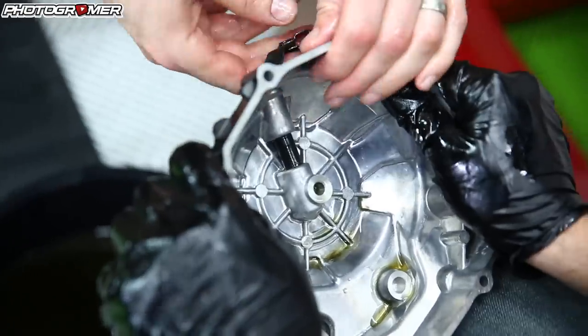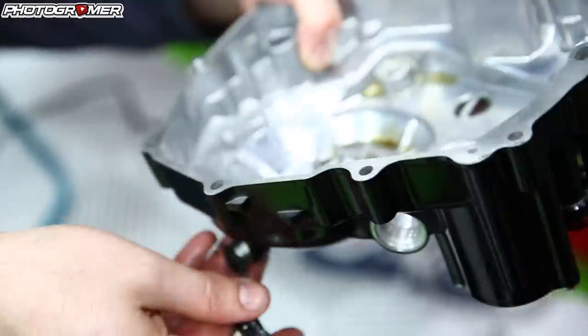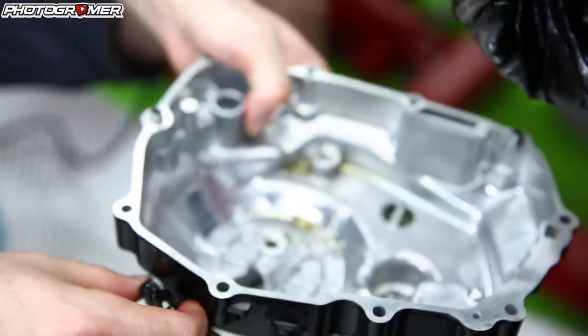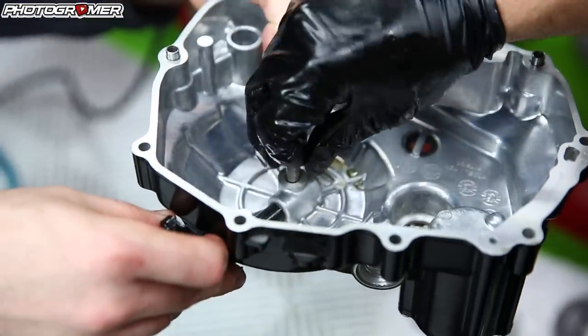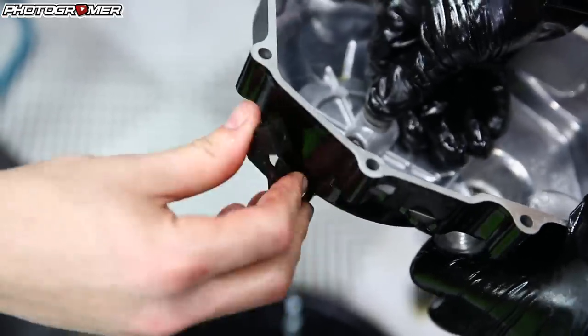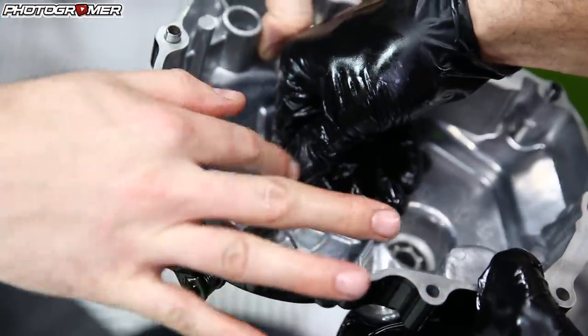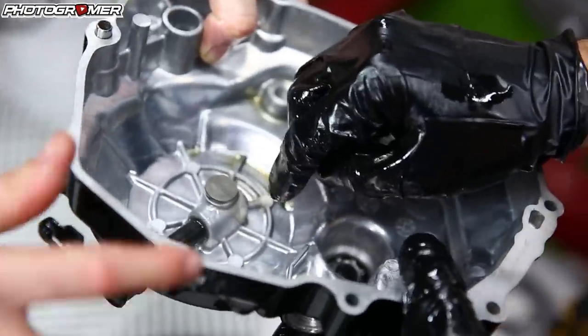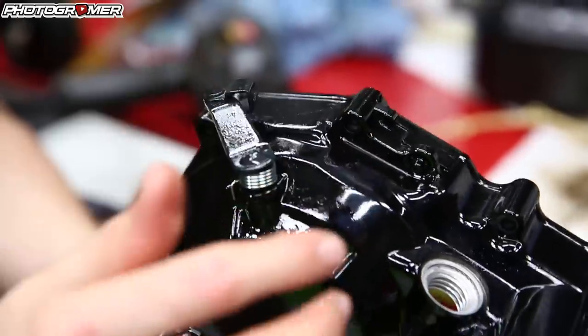Make sure we have the notch showing, then put the plunger in there. Him pushing down, we should be able to push up and push down — that's going to be the plunger pushing against the pressure plate. The clutch cable will go in there. Now we're going to trim up the oil fill dipstick. You're left with this little bullet nub. We're no longer going to need the dipstick anymore because we're going to have a sight glass.